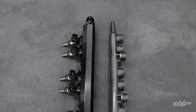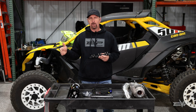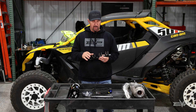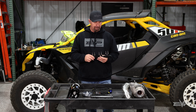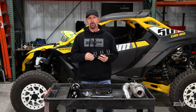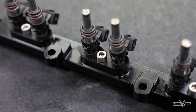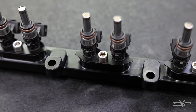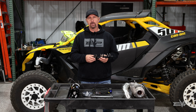The fuel rail has 30% more capacity than the OEM, which is really important with E85 big horsepower tunes. We don't want to starve an injector by running out of fuel in the rail, and having that extra capacity gives us some overhead. The last thing is we got rid of the OEM injector clips, which are really troublesome to get on and off. Instead, we have this elegant retaining clip made from spring steel — it's one clip per two injectors, secured with a socket head cap screw, which is really, really nice.